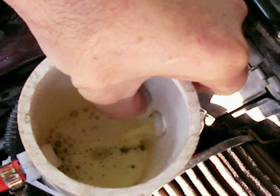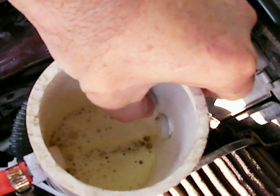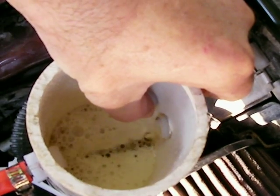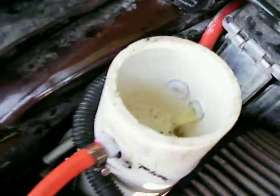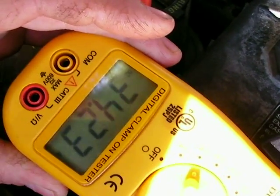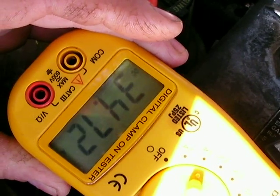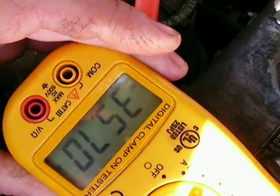It's not squirting out. That's the output of the dry cell out of one tube. If you take your finger back off it, you see it just calms right down. It's at 33-34 amps — so you know it's cold. That's the startup amperage. I'm hoping it'll hit about 45 amps, maybe 50, when it's hot and running.